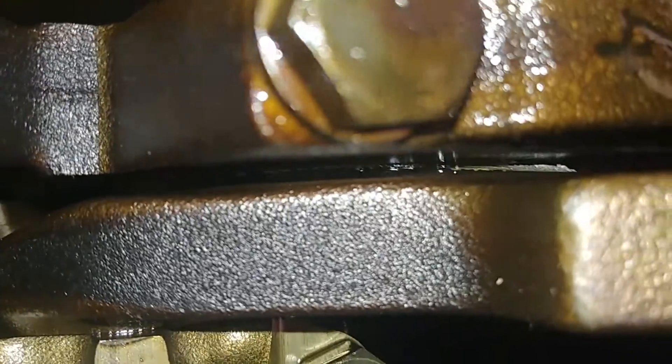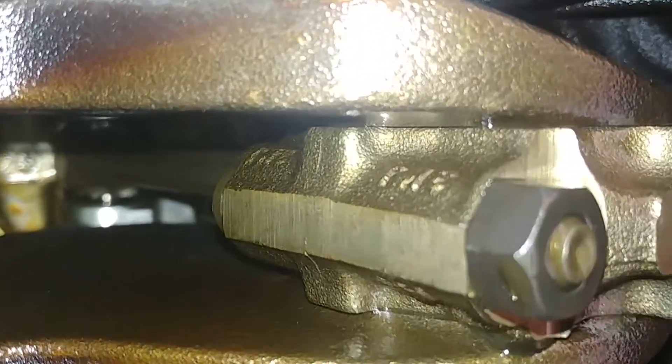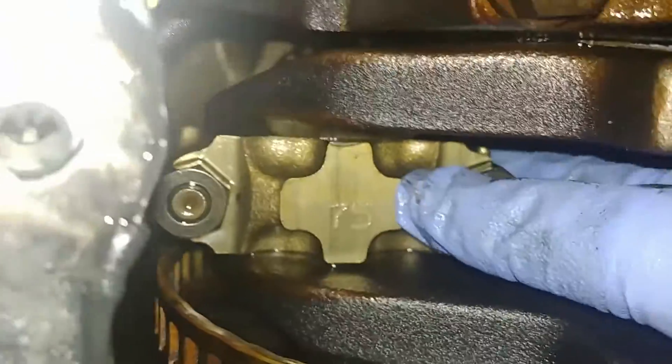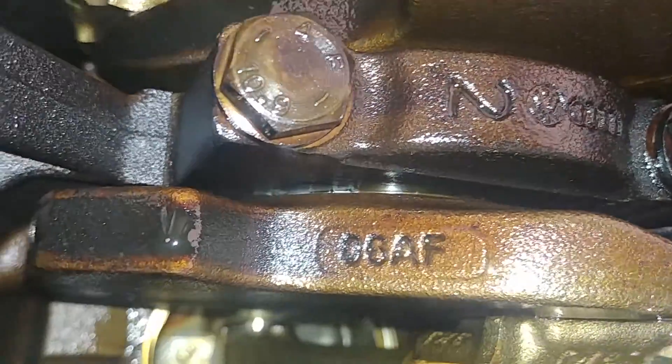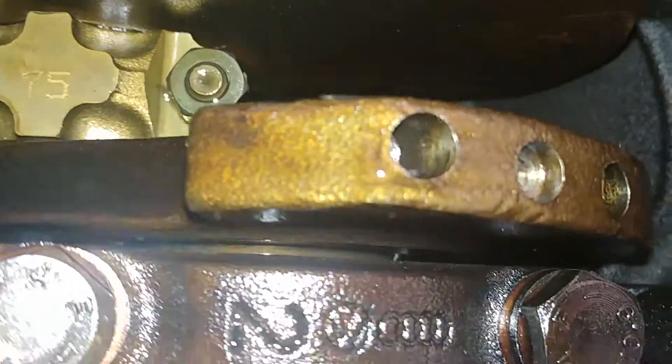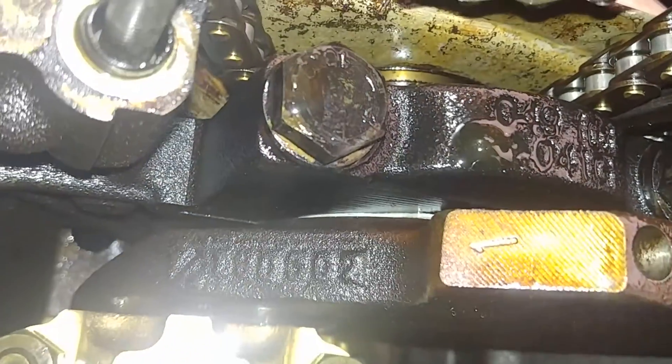I hope there is no scoring on the bearing itself — probably those inserts can just be replaced and the engine will be good to go, but we still don't know. The previous owner was driving the vehicle and the oil pan cracked. The engine ran out of oil for some period of time, and that's the result of oil starvation on the main bearings. Now we know why we had such low engine oil pressure. Oil pump doesn't create pressure — only the clearances between the parts make pressure. We verified that the main bearing inserts are all worn out, which caused the oil pressure to drop significantly.